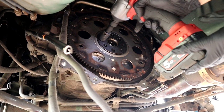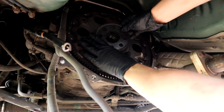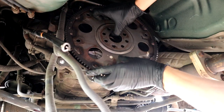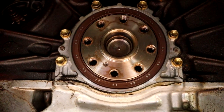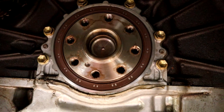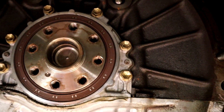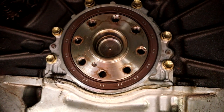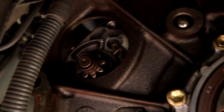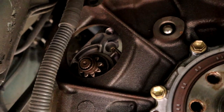Here's the last one — making sure it doesn't fall on my head. There's a little plate first, then the actual flex plate, then another little ring. Now that the flex plate is out we can see the rear main seal, which we're going to change. They look like 10 or 12 millimeter bolts, six of them to take out. After that we'll clean it up, take the rear main out, put the new one in. The starter motor is visible here too and doesn't look like much fun to position.